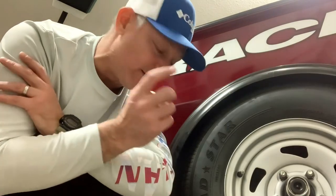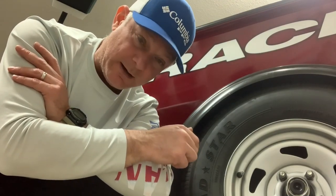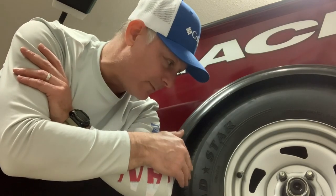Something else I want to talk about is the single leaf spring. The single leaf spring is on the 2021 and prior models. I believe at some point they did have more than one leaf spring, and the 2023 models have three leaf springs — so you're good if you're buying brand new. For prior year models, it's a problem: if that leaf spring goes, you don't have any backup, which could make for a really bad day. I'd highly recommend replacing the single leaf spring with two or three for a much smoother and safer ride.